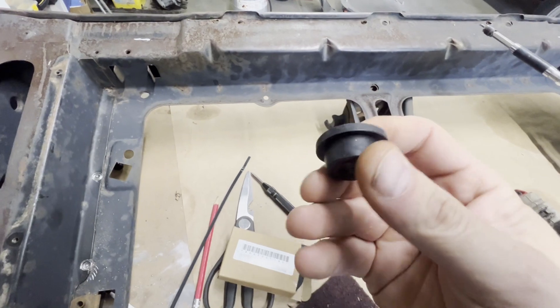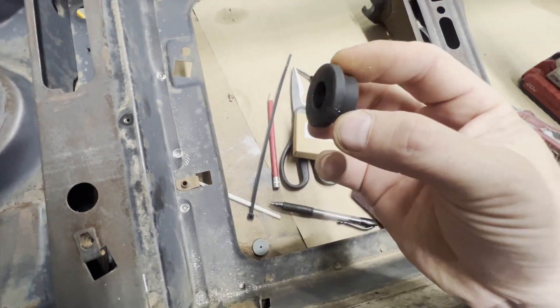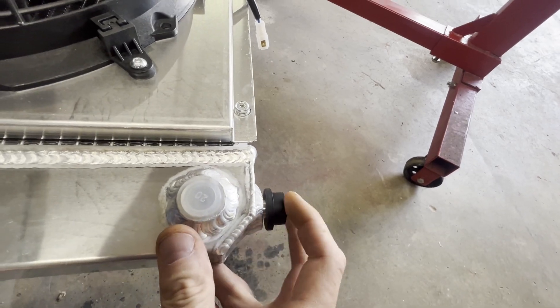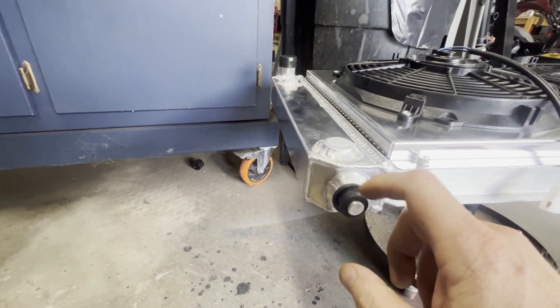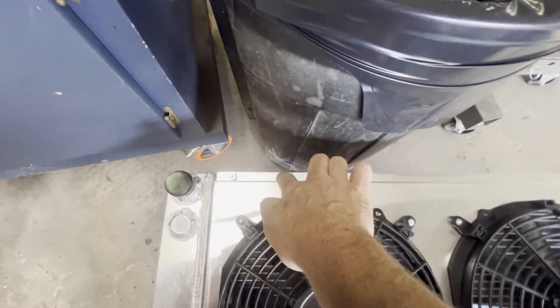I'll put the links to these grommets in the description. I plan on drilling the hole here and putting these in as isolators, so the radiator will have a rubber mount to sit on. I found these on Amazon — they're the perfect size diameter and the perfect cushion to fit those posts on the bottom of the radiator. I'll take a step drill and drill this out so it can set on something rubber. For the top mounts, I may bolt this to the top of the core support, or I may even use the old 4.3. We'll get it all cut out, get it painted, and put it on the truck to see what it looks like, so stay tuned.